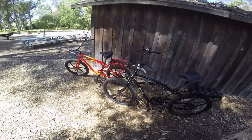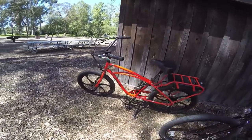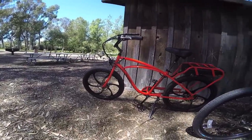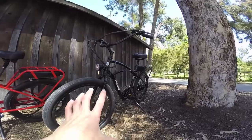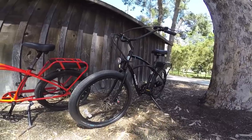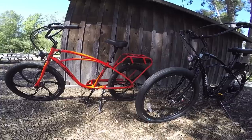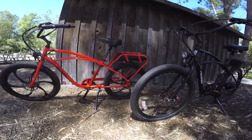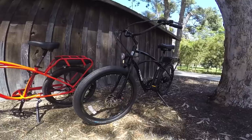All around, really great bikes for what they are. Pedego has been a leader in the US for a long time, focused on this aesthetic with a great warranty — three-year battery warranty, fully covered the first year, then pro-rated in years two and three. The replacement battery is $800, so take care of it. These use high-quality Samsung lithium-ion cells that should last a thousand-plus cycles if properly maintained, though they will degrade over time like any battery.